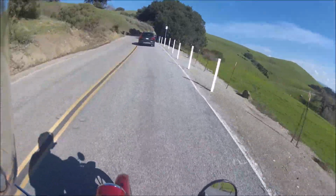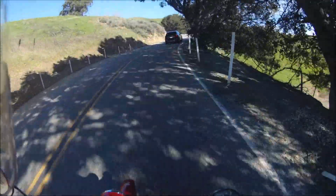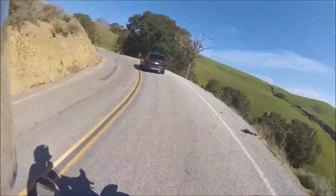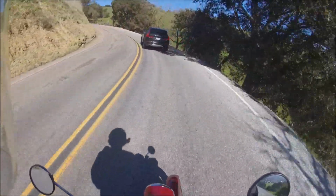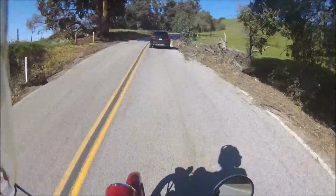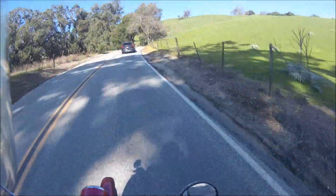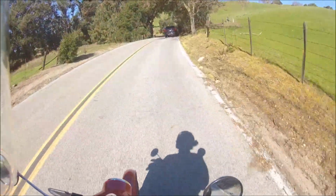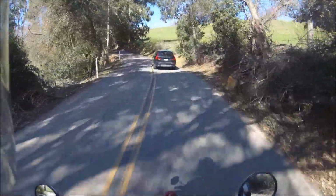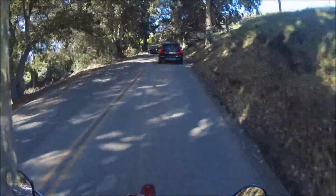It's okay. I'm not really interested in going really fast anyways, guys. I just wanna test out how the ride and the handling feels. That's the main deal. It is a little bit stiffer, all right? I would say it just feels a little bit stiffer than it was before. You'll notice that the handling is sharper, it wants to turn quicker, for sure. It's like if you kind of overinflated your front tire a little more. Maybe if you wanted it to ride a little better, you could probably go down on the tire pressure.